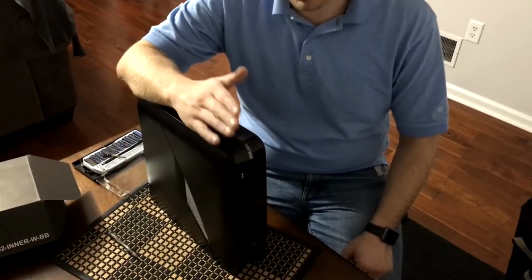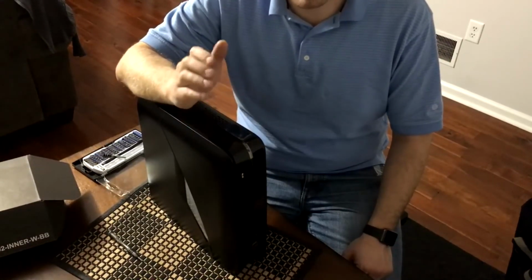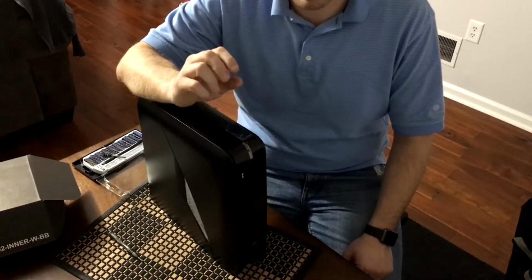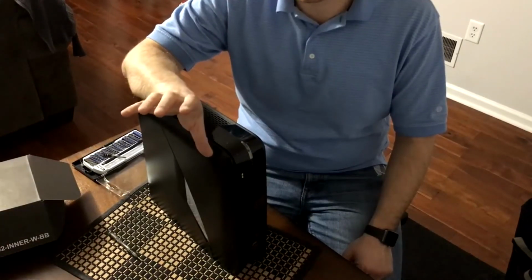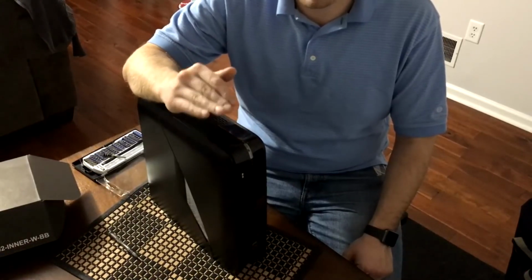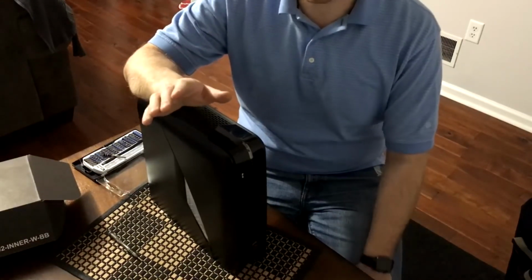This worked well. I mean, we didn't install drivers yet, but really it should just be as simple as powering it on. It should automatically use that new graphics card, because the old graphics card was the same form factor, PCI Express, so the BIOS is going to already be set up to look for that card there. So it's going to probably boot into Windows without a problem, and when it does, it might look a little sloppy, but that's just because we need drivers.